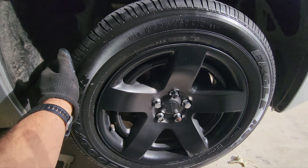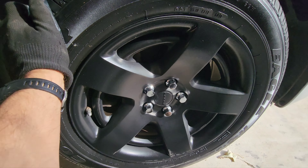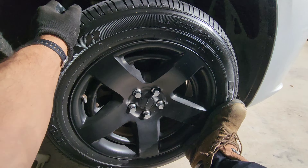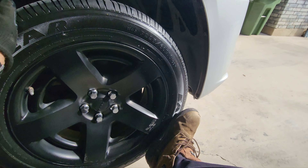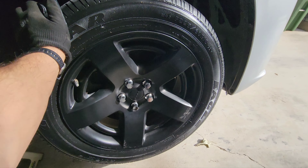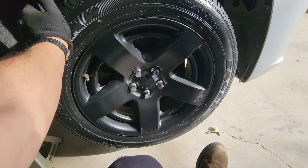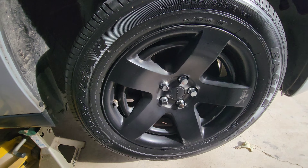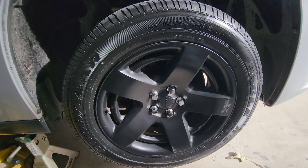Last time I wiggled left to right, I didn't get anything. But now I'm getting a little play in the bearing. Both sides are about the same. Almost sounds like a loose rotor, but it's not. When you change the left to right steering, especially in reverse, you get a snap. So I'm going to change out one of these hubs.